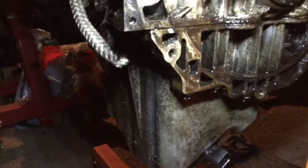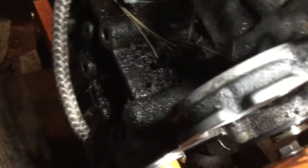This is the split line right there, so that's mainly that. The crank seal doesn't seem so bad — there's a bit of black, but I don't think it's all that. Maybe a little bit on that side, but not much. It's more the oil pan gasket.